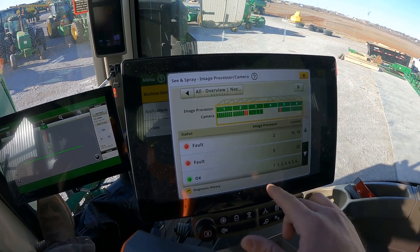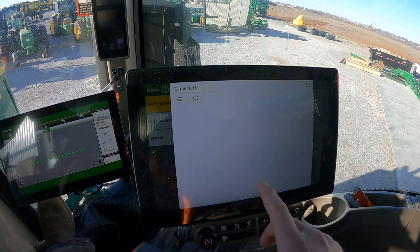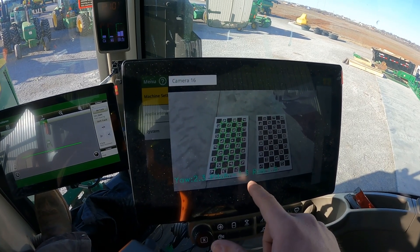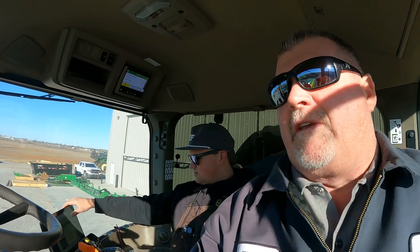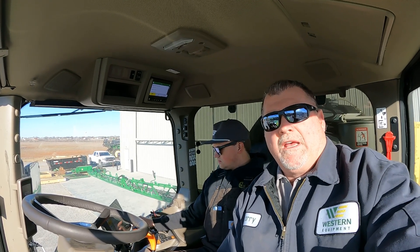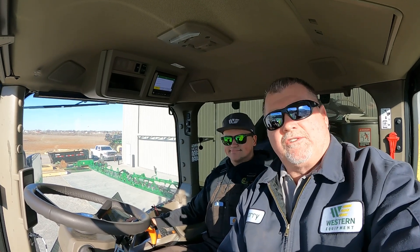You have to add washers and shim it to get those within spec — that's what we're going through right now. It didn't pass that time, so what we can do is go to diagnostics, select camera 16, and it'll pull this up. Here's our yaw — our pitch is what's out of spec. It gives you a spec of plus or minus three, so we're three-tenths out of spec on that. I'll have to go adjust the pitch just a little bit more, recalibrate it, and we should be good. That was just a quick overview of what's going on in the cab when running this calibration for individual cameras.